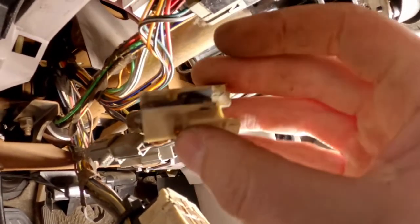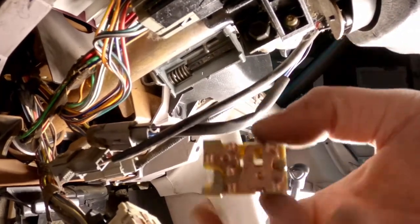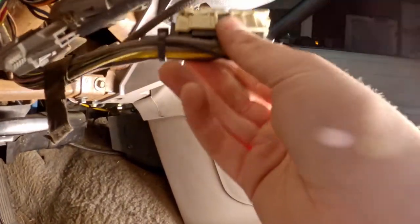The easiest way to reconnect is to take your top piece and put it in with the open side facing towards the front of the car. Stick it up in there and slide it into the little pin right there. Then take the bottom half of the switch — the connector — push it up onto that piece, push it towards the back of the car, lock it into those two tabs, and push the back side in until it firmly seats.